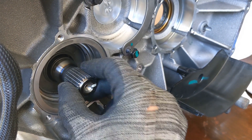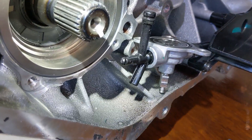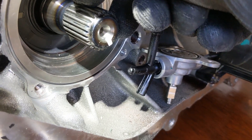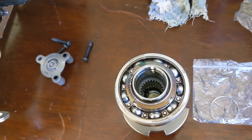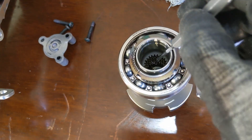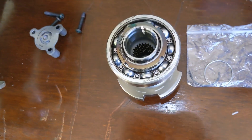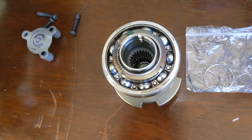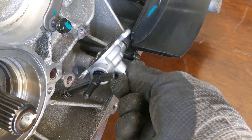I feel no play in either axial direction or any radial direction of this rotor — nothing, it's held very well in place. Also there is no visible significant wear in any of these spline teeth; they're all the same width from start to end. So maybe the wear takes place on the female part of the spline. If you feel from top to bottom it's totally smooth, no jumps — so on first sight no signs of wear due to electric discharges. Nice to see is this little oil pump — this is the axle from which we removed the black gear.